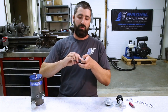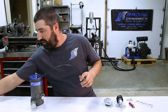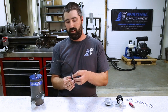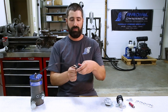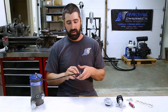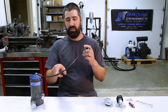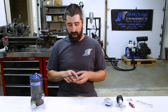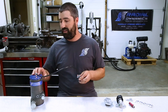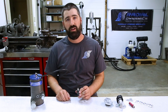This valve is very simple to install — just push-lock tubing right to the vent port on top of your reservoir. It's also supplied with a cushioned P-clamp so you can easily mount it somewhere near your reservoir or in your chassis wherever it fits best. It can be installed in any orientation: vertical up, vertical down, or horizontal — that doesn't really matter. It doesn't necessarily need to be above or below the reservoir, though if it is above, any oil that gets into the vent line can drain back down. You can pair this valve with your second-gen Vortex reservoir, and this hardware pairing will give your pump the absolute best shot at delivering the highest performance it's capable of.